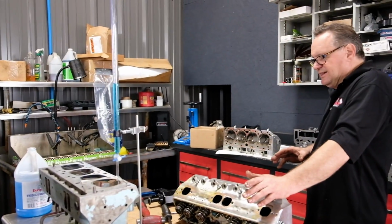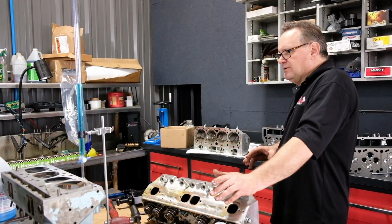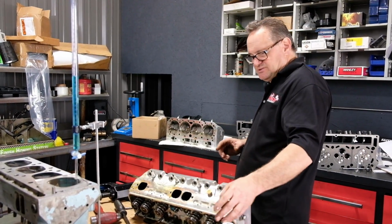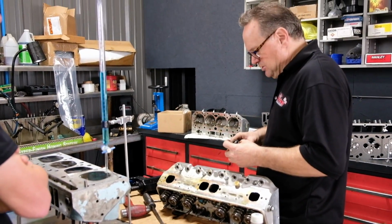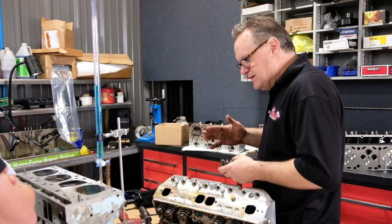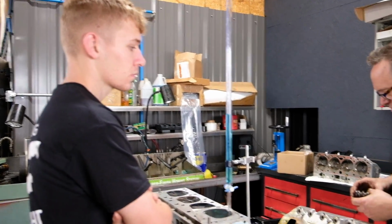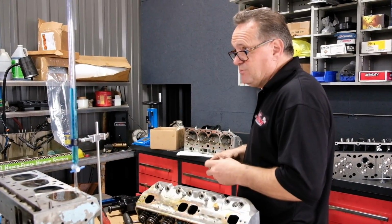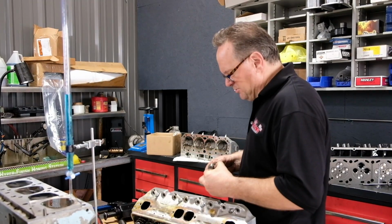But when you said last time that you broke a lifter, I was concerned that truly it was something, and we need to check the pressure on these springs. That this was bouncing. Yeah. You know, let's say if we're losing a little pressure here and that's not returning well, maybe the lifter is literally bouncing on the camshaft. It's not keeping it down. Because as I recall, these springs were the better of the other springs versus his. Yeah. But I think we shimmed them a little bit to get them a little stronger. Now, moving forward, I think you ought to put a set of springs in it.